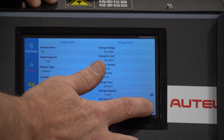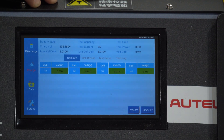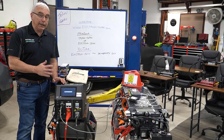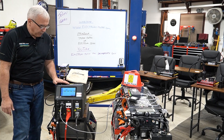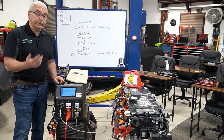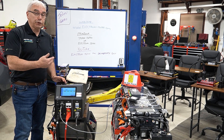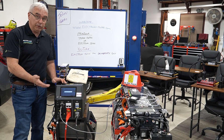I'm going to hit the save button, say start — we're starting with a voltage of 235.58 volts. I've got to wait until I hear the fan kick on, and then it will actually start charging the battery pack. On the screen it also displays each one of the module voltages. Now that it's charging, we're at 236 volts already, now 237. I set it up for a 10 amp rate of charge. Once it's all said and done, I can either set a timer so it only charges or discharges for a set amount of time, or I can just let it go until it's completed and it will shut itself off.